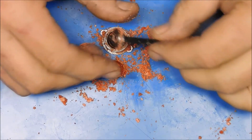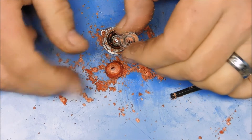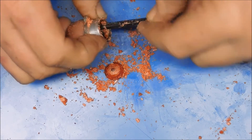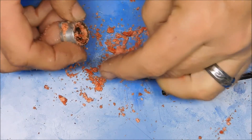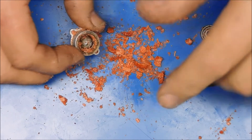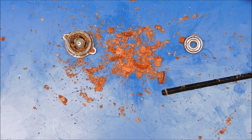And there you have it — sure enough that method works and it works quite well. Now I wasn't really planning on replacing this bearing, so I've got to find some means to clean this off and clean all this out. But you can see the bearing comes out just like that, and that is an effective means for removing these camshaft bearings. Obviously the same thing can be done on the inside of the engine if the bearing feels bad. So there you go — a demonstration of how to remove a camshaft bearing.